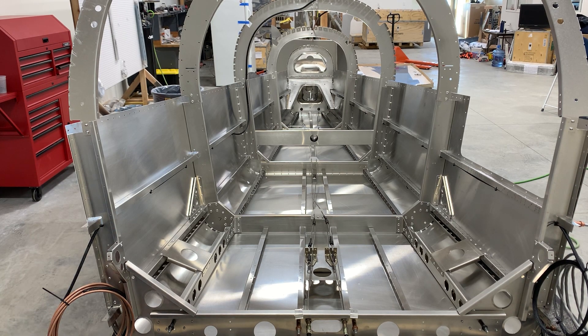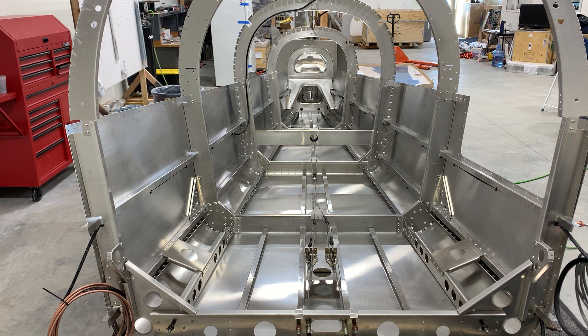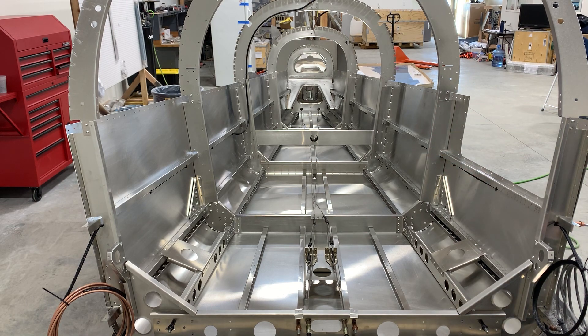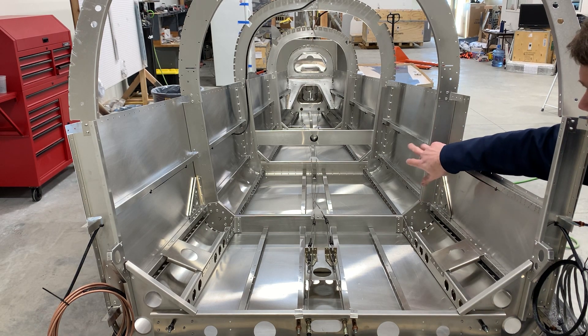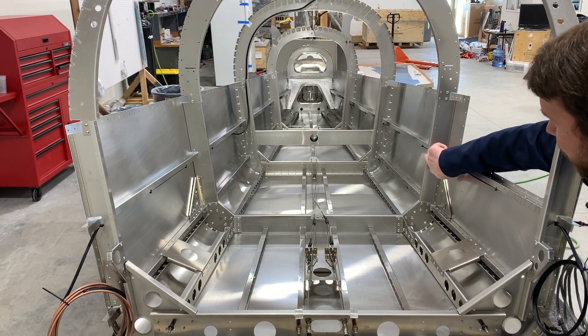On the left side of the fuselage — the right side of the screen — along the top and bottom ribs, I ran the four-core and six-core wire, of which we'll actually only use five wires for the trim servo and tail strobe. Run them down your longerons; there are pre-punched holes where you can fasten the wires down with zip ties. Alternatively, you can use P-clamps or Adel clamps along the way.